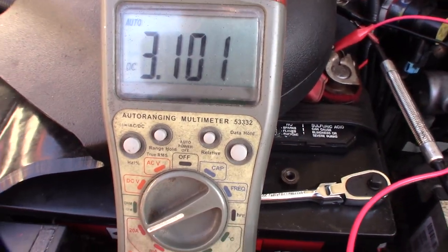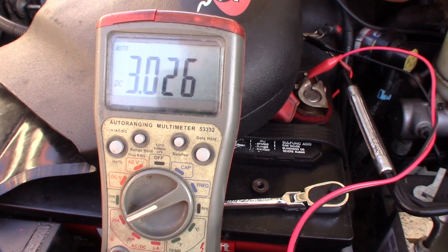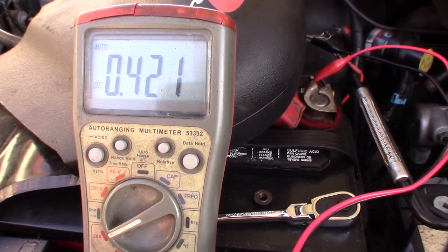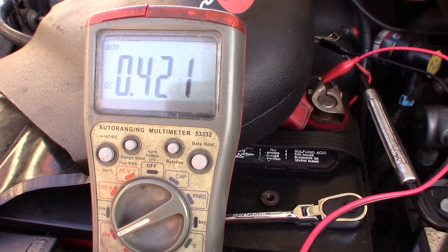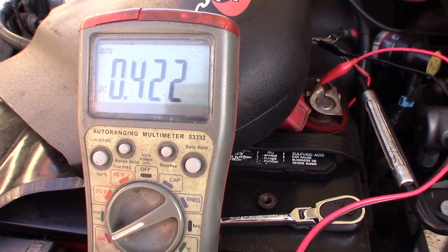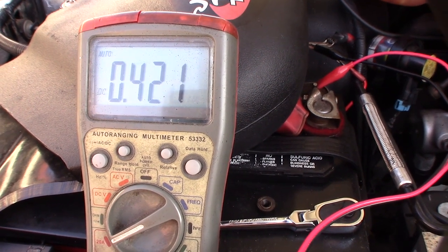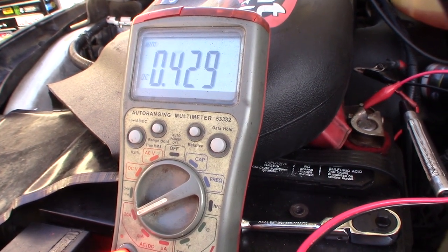I just opened the door and the light's on inside — I'm pulling about three amps. It'll come back down once the light goes out; it went down to about 420 milliamps, then about 300. I'm going to wait about a half hour and come back to see what happens. It should be about 30 milliamps if this thing fully goes to sleep. It's been about 15 to 20 minutes and I'm still pulling 420 to 429 milliamps. I'll come back in another 15 minutes.